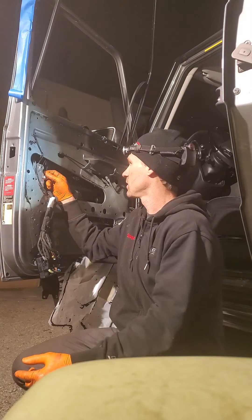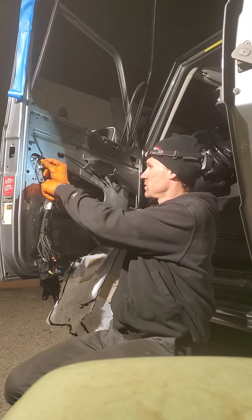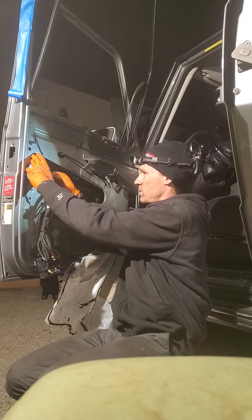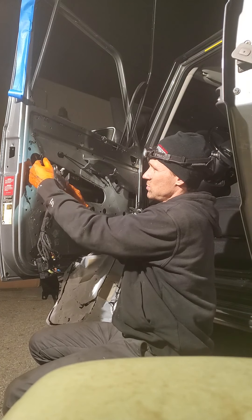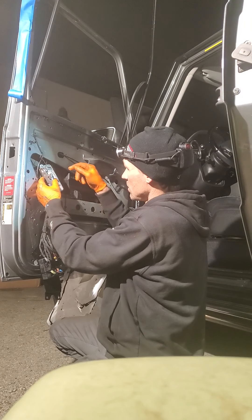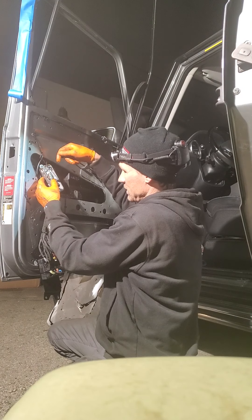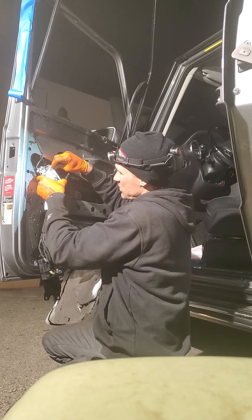Things to remember though is you've got this cable here connected to it still. It's pretty easy to see how to take that off and change it - if you've forgotten there's just a little metal clip. Now when you take this out there's also an electric plug micro switch here - it goes to telling when the door is open or not. It's glued on so you're going to need to use a very small flathead behind it to pull it out. There is also a clip that holds it on, which basically just springs over the metal. There's a little bit of glue on the top side to hold it in and it just pops into this little thing. And that's how you take it out.